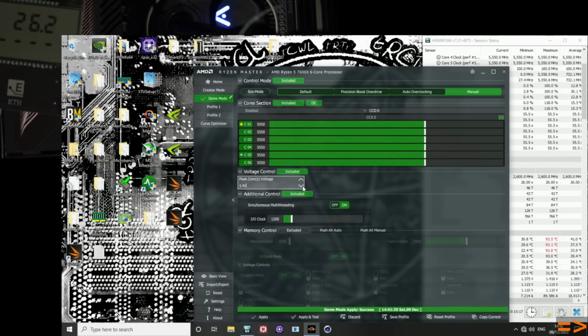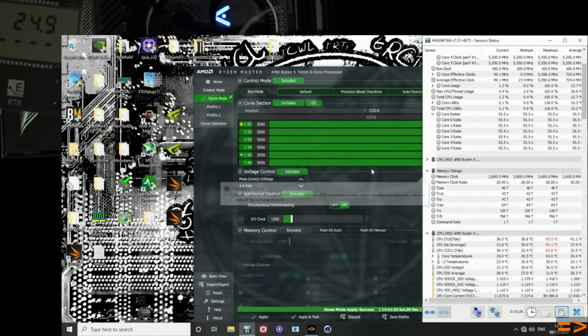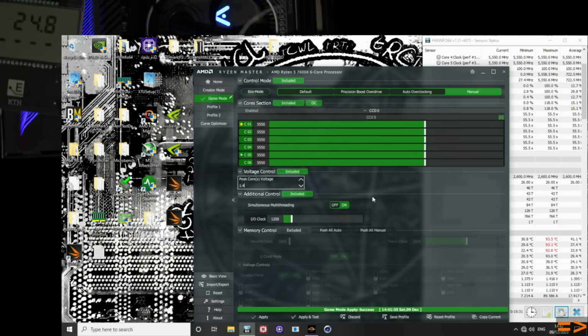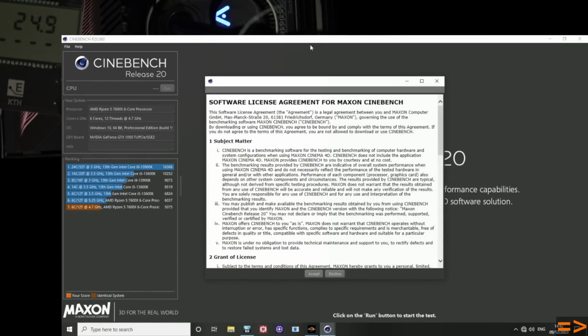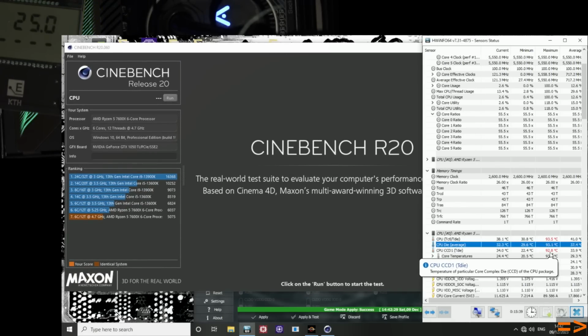And if I lower the voltage back down again, the thing is, the temperature we're seeing in HWiNFO isn't even that high. And yeah, you could argue it's because your update rate is once every second, so I'm not on some crazy high update rate for the sensors. But I don't think that would make a difference, because you can't have a temperature sensor on top of every single transistor inside the CPU. You just can't. Modern chips have a lot of sensors in them, right?